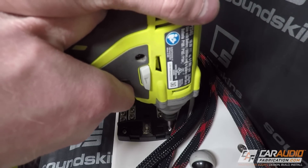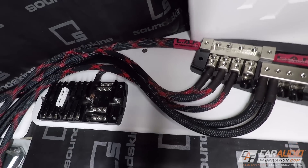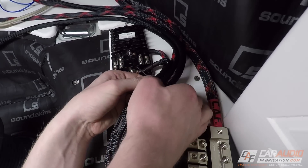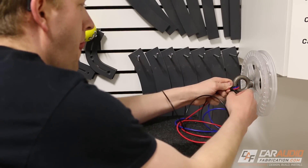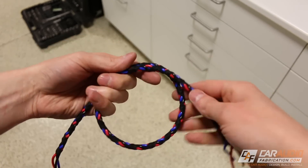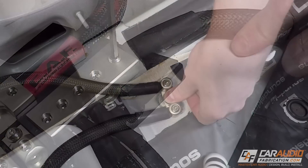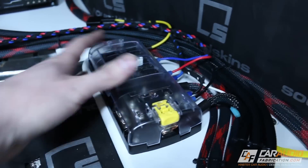I can now get back to mounting this secondary fuse panel, and then I'm going to connect both a positive and ground wire to that panel. That secondary fuse panel actually has two different banks of positive leads — one will be a constant positive lead, and the other bank will be for switched positive. I'm using zip ties to make everything nice and organized. I'm making a quick little bundle of wires using the Mobile Solutions wire spinner, connecting one end to the DSP and the other end to my secondary fuse panel. Back on the main fuse panel, I install a fuse for each of the amplifiers and for the secondary fuse panel, secure the ground wire to the fuse panel and to the body of the vehicle, install the fuse for the smaller items — which so far is just the DSP — and add the cover plate.